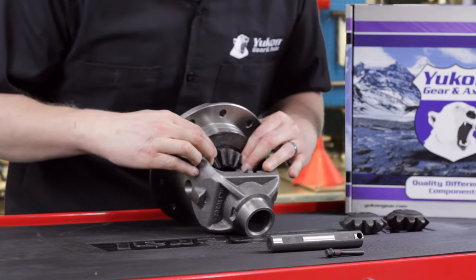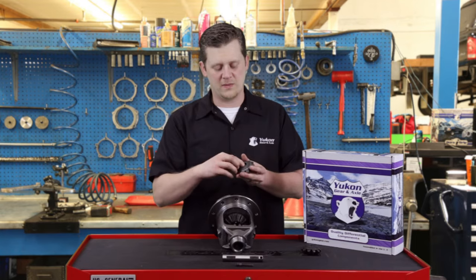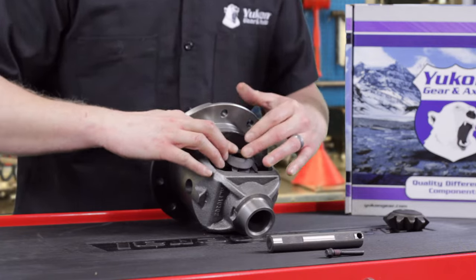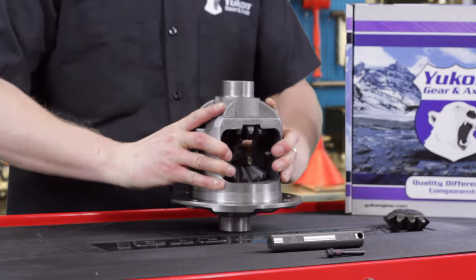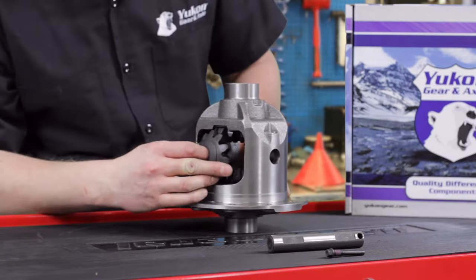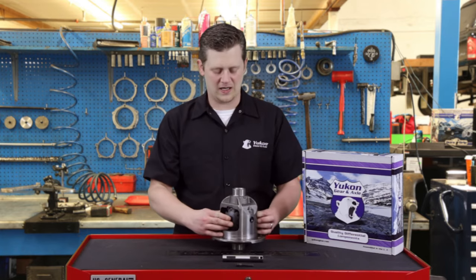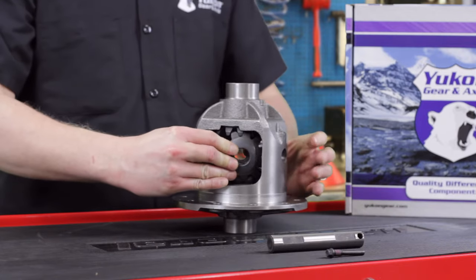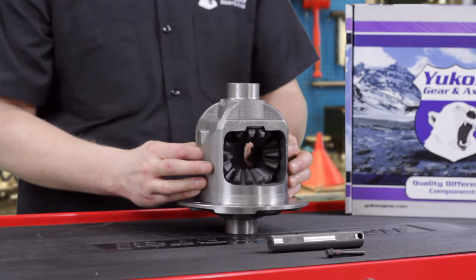What you're looking to do is line up the teeth so that you can take one of your spider gears, along with a thrust washer that's tacked onto the back, and set it into the teeth there. You want it lined up so that it's even and straight up and down. Now you can set it on its side and do the same thing with the other side. Because if you don't have it lined up properly, it's not going to line up with the holes for the cross pin shaft. Now that everything is in there, just rotate this whole assembly and the thrust washers will actually hold themselves in place once they get into their little spots.